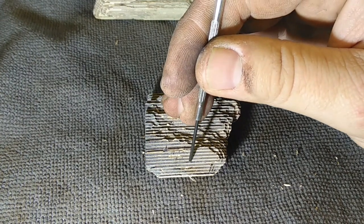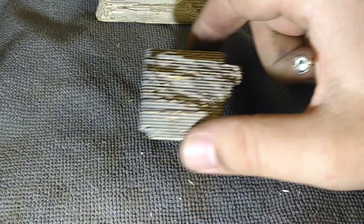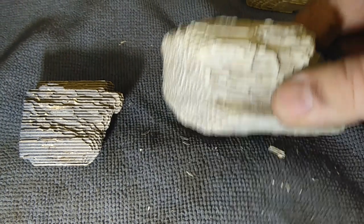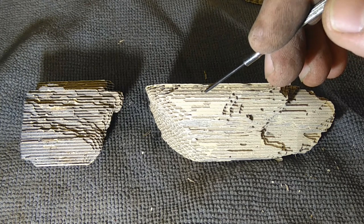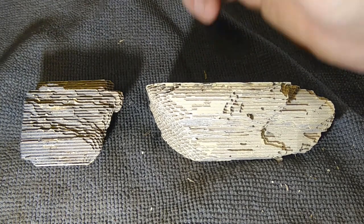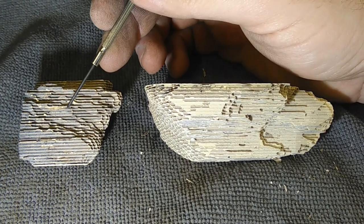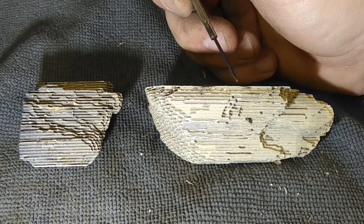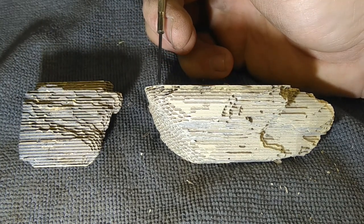So although the rear might look okay, the front, as you can see, if you take this as the front part now, and we look at this, let's see if we can find a nice spot. Look there, there's almost no soot here. And even to the rear. Only in the front. So it looks like the front 5 to 10 centimeters basically causes a blockage, because it builds up and builds up here, nothing gets to the rear. Or it gets through, but it puts way more restriction on the engine than it should.